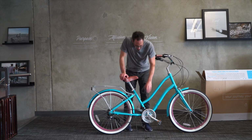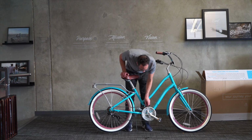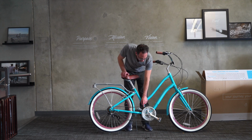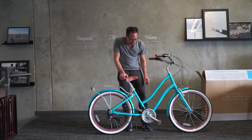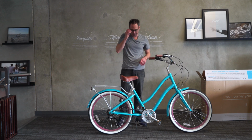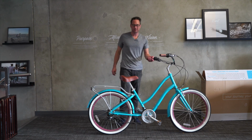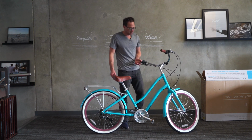And actually the distance above the chainring here for the derailleur is more like maybe 2 or 3 millimeters. Just whatever works. It's a little bit of a judgment call there. The front derailleur is a little bit more art than science sometimes. So, okay, there you go.